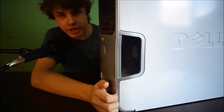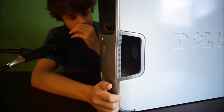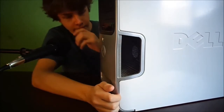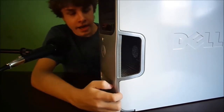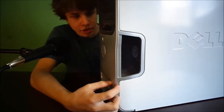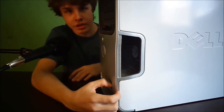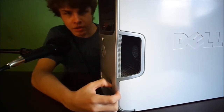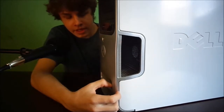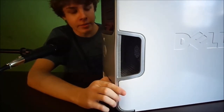Since this is the original fan to the system it is running at full RPMs, as it doesn't have a heat sensor to read inside case temperatures. It has a Dell Optiplex 745 board in it right now, so it runs at full RPMs, which is perfectly fine because this is going to be used as a server and I want to keep it as cool as possible. People dispute fan orientation all the time, but I've seen an improvement — particularly with copper heatpipe-style heatsinks seeing a pretty big improvement.